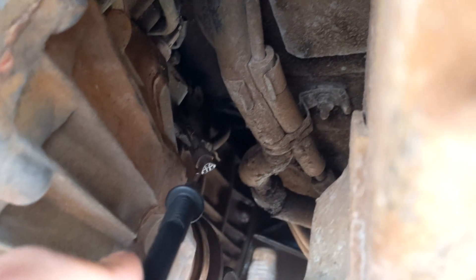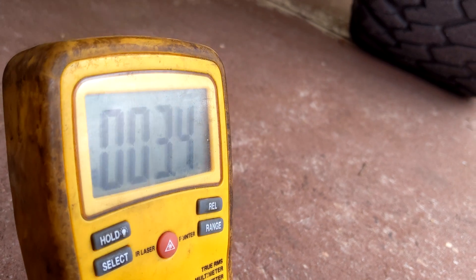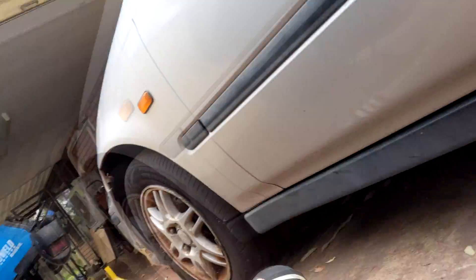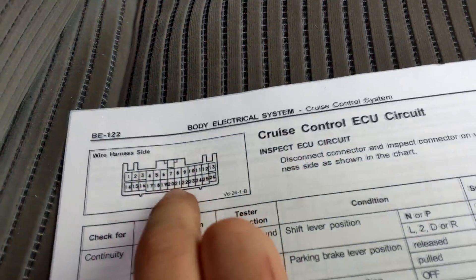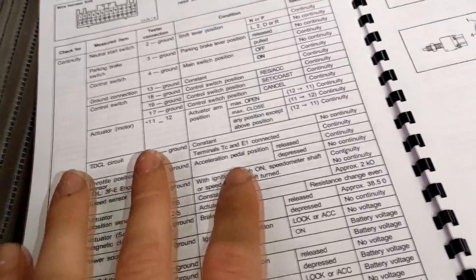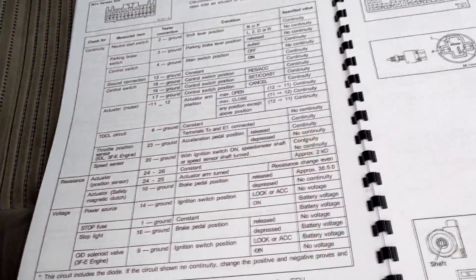This little connector here is the speedo connector. I've checked battery voltage and I'm definitely getting 12 volts there. Now I'm just going to check continuity of the cable for the speedo with my multimeter on continuity. You can see I'm getting continuity there - three ohms, two ohms, good continuity. I've got the connector out and the multimeter jammed in the back. Pin 20, which is this lower pin here, is the speed sensor wire. I know I've got continuity on that wire, I've got voltage at the plug as well - a nice stable 12 volts. So basically it's got to be the sensor - either the cabling from the sensor or the sensor itself.